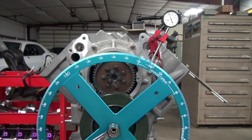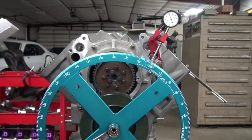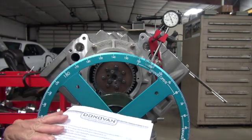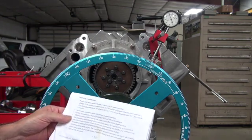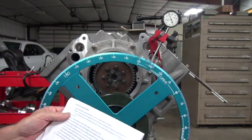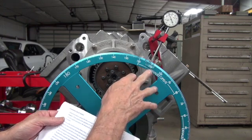I should have done a disclaimer at the beginning of this video that I don't know anything about a gear drive and I don't know what I'm doing. But I have done it a few times in the last 40 years and it's always worked. I've got Donovan's instructions here on changing valve timing, and we'll see if she wrote out good enough instructions for me to figure out. So we're going to advance 4 degrees — the intake centerline is 111, so we're going to 107.